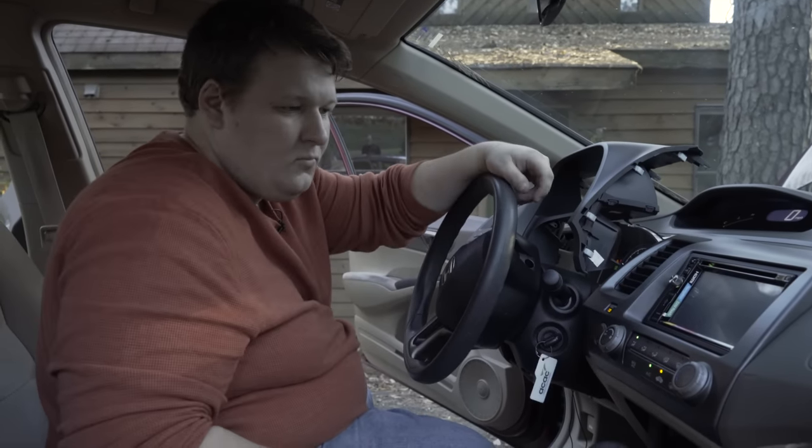So now we've got our new speaker — we've already gone ahead and mounted it to the adapter bracket. We're going to take the harnesses that were provided and just plug the positive (the big one to the big one) and the small one to the negative. Now we can go ahead and slide that back into the door and connect the harness. One thing to make sure is that our terminals are oriented not near the bottom, so that they don't short out against the door — that could cause all sorts of problems, so just make sure you've got plenty of room. Go ahead and reattach that screw and your speaker will be mounted.